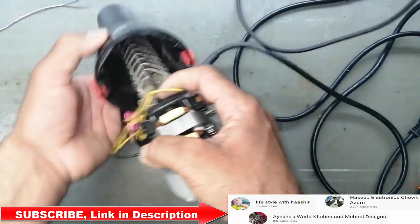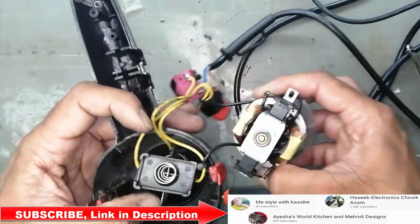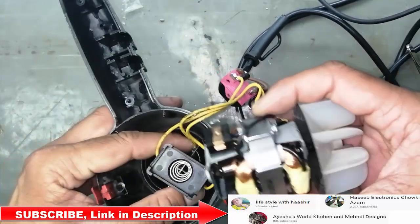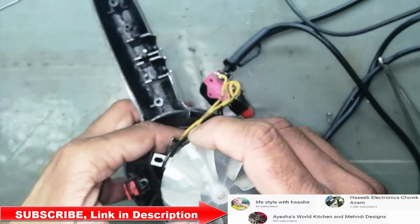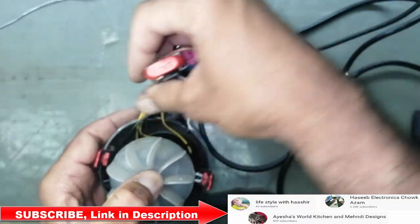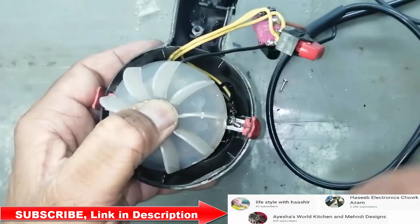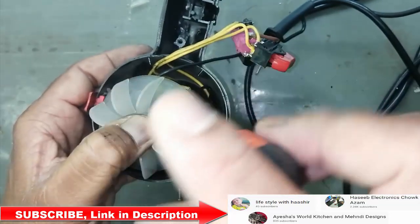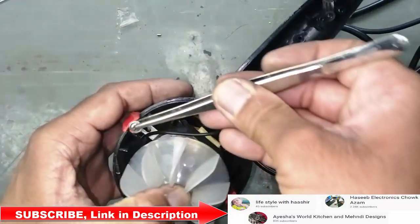Adjust it, put in this spring. This spring is to protect against the vibration of the heating element, because when the blower fan rotates, the heater may vibrate, but when we install this spring, it works as a shock absorber. Okay, connect these two screws here.